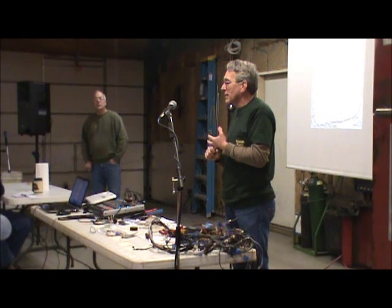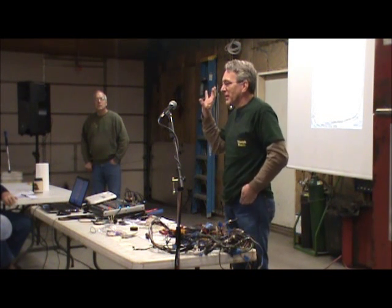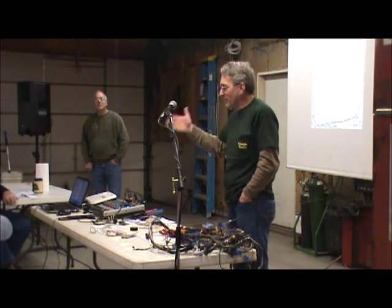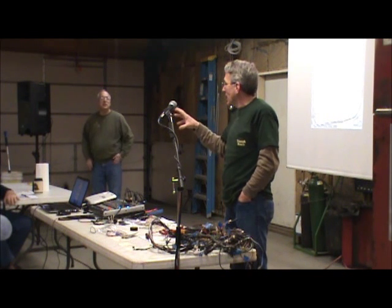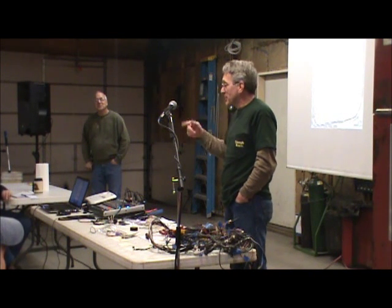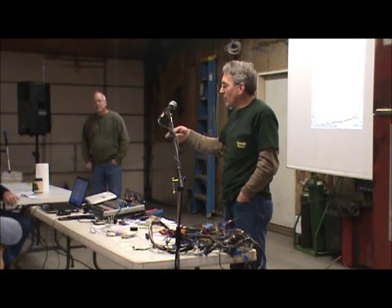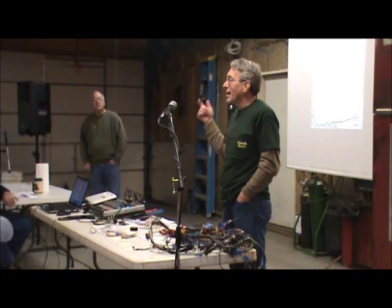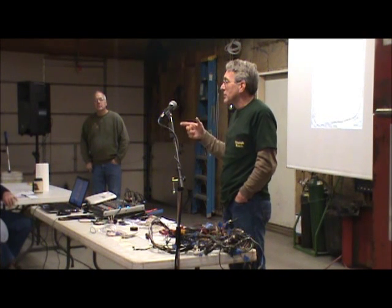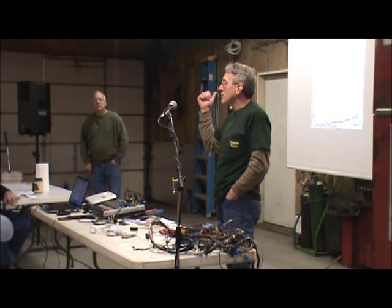I have an old Mini which I use every day, and I took out this single little horn that you could barely hear, it sounded like a baby belching, which was also kind of girly. I wanted people to hear me coming. I put 2 horns in it, and I pushed the button, and they didn't make a sound, but the single horn worked. I couldn't put enough through this switch to make it happen. So now the horn button triggers a relay, which fires the horns, and they sound nice and loud. When you go to a relay upgrade, you're taking battery power to run the load, not letting it go through the switch. The switch is just firing the relay. That's always a good upgrade.